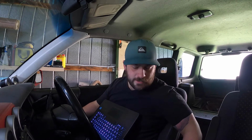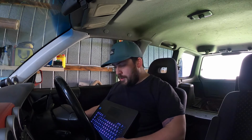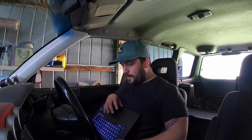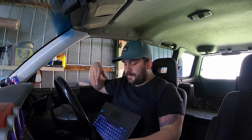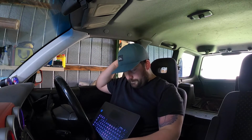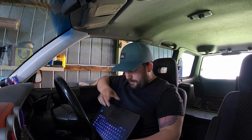I've rescaled the MAF a little bit, added 5% from 2 volts down, so let's see how we go with that. I'll just write that in. So I did 5% under 2, and then I think I did like 5 cells above that at 2.5 to smooth it off. Yeah, done.